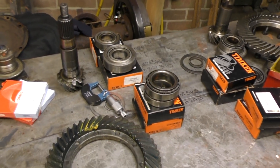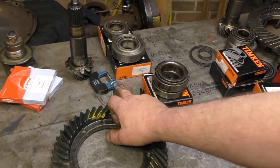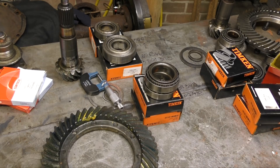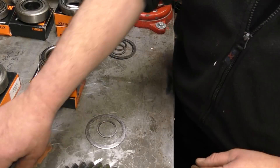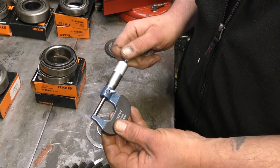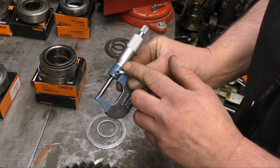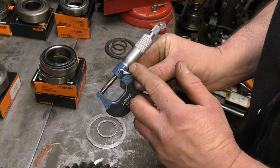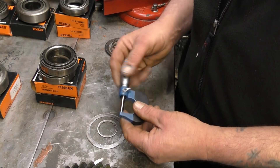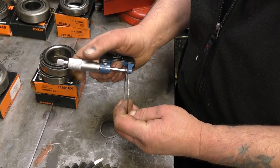So we're ready to do some measuring. We have some shims here, and these are really important — we need to measure these and record the numbers. I've got two sets of diffs. First of all, the micrometer — I'll show you how to use one in a different video. Always make sure it's zeroed because you can be off a little bit and it does make a difference. They're only selected shims; they don't come in every single size, but we want to ascertain what the size is.